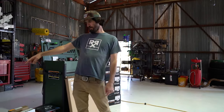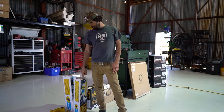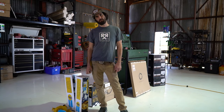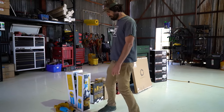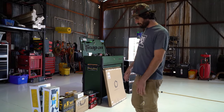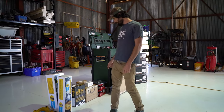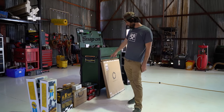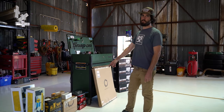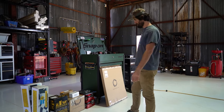So yeah, parts wise, we're using the super simple off the shelf Bilstein HD, nothing fancy at all. It's like an OE replacement, a little bit upgraded. It's gonna be a bit stiffer, and we use these in a lot of our rally school cars. They work great for some period of time at least. King Springs makes like a 2-inch lift spring. So instead of putting like a lift spacer, which a lot of people do on the Subarus, it's actually lift it with the strut assembly. Primitive, we have the front skid plate, KNS brake disc, and then just the factory 2-pot, 4-pot calipers. These are just like the Rock Auto specials. These aren't even the OE Subaru calipers. They're just the remands because falling on a budget.